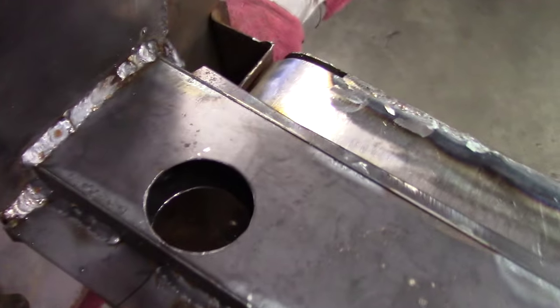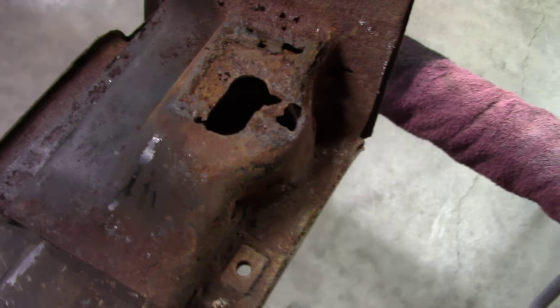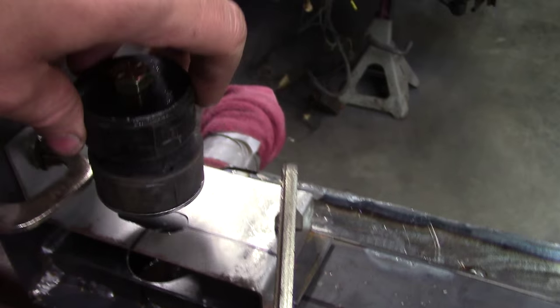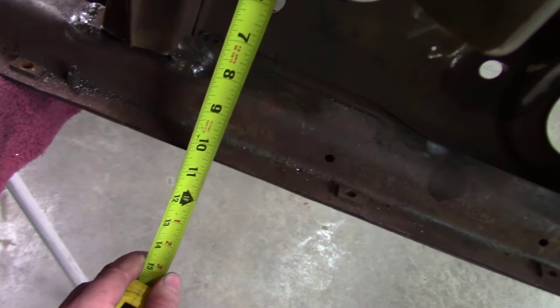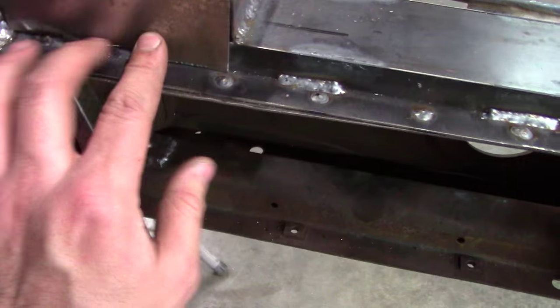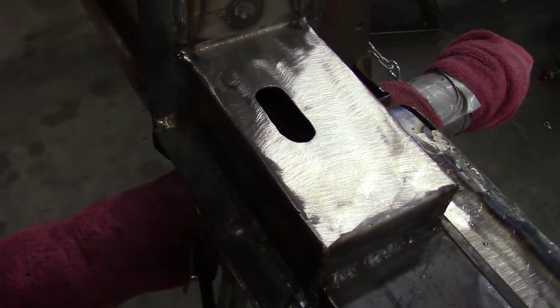Looking at this you might say, oh no, my hole is off center — but that's pretty much how it is on this side, and they actually made a bump out for that. So things are looking pretty good so far. There's plenty of meat here to catch my bushing. This is the aftermarket bushing I found for this core support. The ones that were on there — those square ones — I do believe were original, which is why they may have had this bump out for a wider seat surface. Important thing is I got my distances. I took a flap wheel and rounded the top edge so it wouldn't dig into the bushing at all.